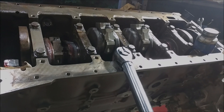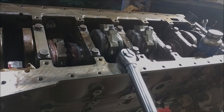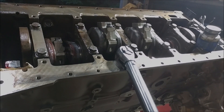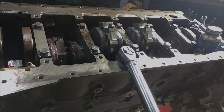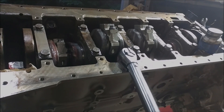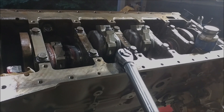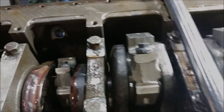Also, when we come back after these are all clearanced and we've got the Ultra Slick on all of the bearing surfaces, I'm going to go back and recheck all of these things to make sure they're tight. If there's any assembly lube that's gotten between the two surfaces, I want to make sure it's had a chance to squish out and doesn't affect the final torque. So I'm going to go ahead and set this to 20 on the torque wrench and then we will get rolling.